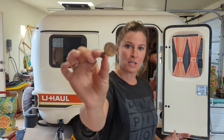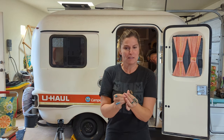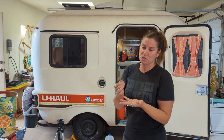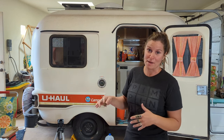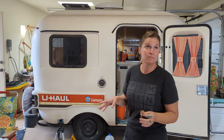Here's what it looks like when we took one elevator bolt out to make sure we were ordering the right product — it's all rusted. Surprisingly I didn't have to cut the bottom nut; it actually came right off and seems coated on the inside. But as you can see these are rusting pretty badly. This camper has had two previous owners, so I don't know if these have been replaced already, but judging by the condition they definitely need to be replaced before I'm comfortable getting back out on the road.